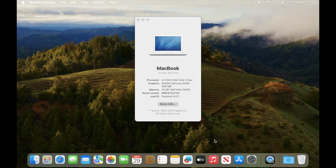Installing Windows 11 on this old hardware is not very easy, but you need to follow some steps. The first step is to create a Windows 11 USB installer, but for this we will need a Windows computer because it works better. For creating the Windows 11 USB installer, we will also need a USB stick and a fresh copy of Windows 11, which can be downloaded from the Microsoft website.